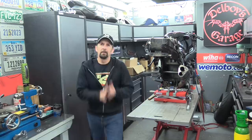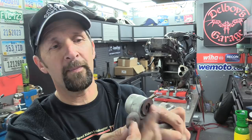Right, there we go, that was it. Day 8 done, tick, that's out of the way. Short link bearings, all 6 of them replaced, and the spacer tubes, all brand new stuff. Also the little shims, when you order your short link bearings, you can order these as well. They're the little precision shims that go between the front mount, which is that one. They go on the outsides of the front mount like that and space it out between the frame. So it's important to get those as well, because with time and corrosion, they will grow.